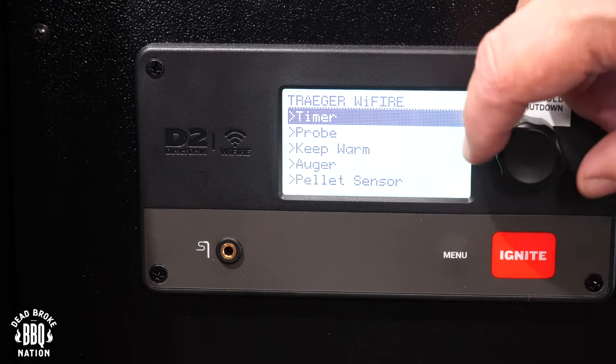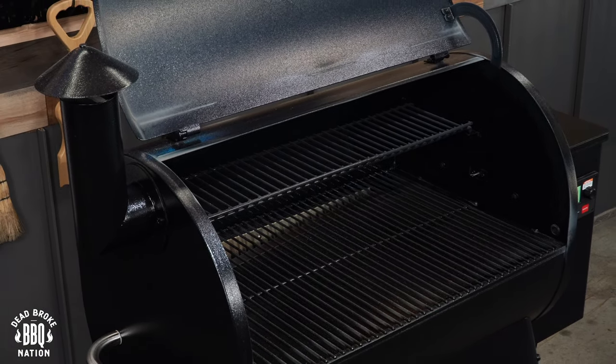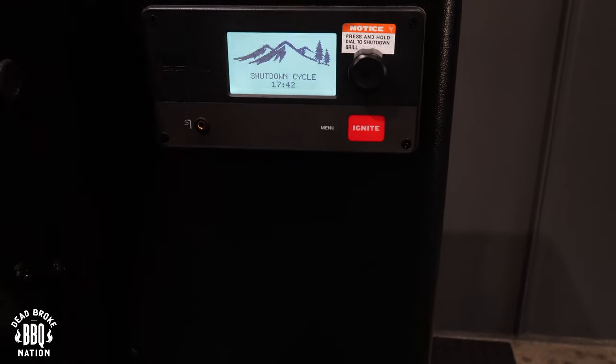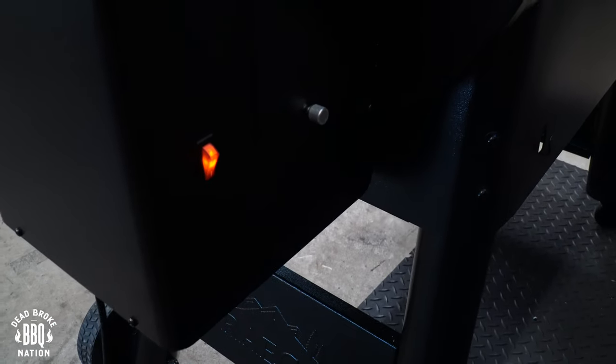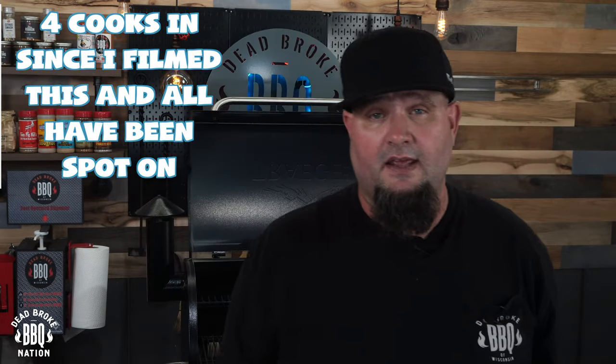My first impression, I really like how this controller operates and some of the features that are on it. I actually love the fact that you can back up that auger. None of the pellet grills that I've had so far have that option. Now, it's supposed to actually help you with an auger jam. Who knows? Might help. I actually like how you prime up this pellet grill and you get them to a certain point and then you just press the ignite button when you're ready to start cooking. You're gonna use that, obviously, if you go ahead and change a flavor in your pellet. And you just have to loosen up this nut, put a pail underneath it, and catch all those pellets if you wanna change them out. And it's actually held up by a magnet. Now, obviously, I haven't cooked on it yet, so that's gonna be kind of the first test to the 780. We'll see how it performs. But the assembly and the burn-off, it went really smooth.